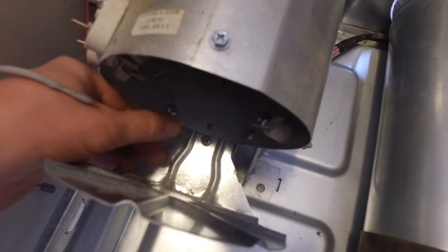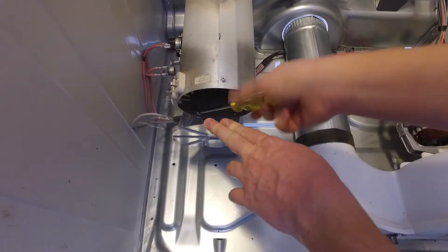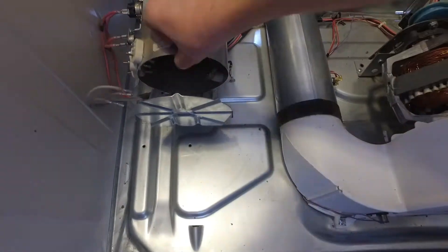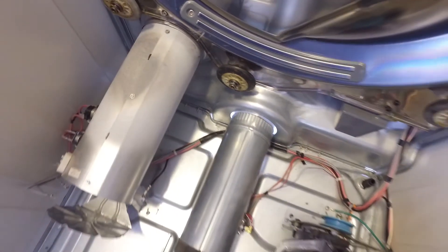We'll need to take a screwdriver — there are two screws on the inside there that we'll need to take out. This metal piece here, you can actually bend that back while you do this. But be careful when you take those out — do not cut yourself on that heating element because you could easily do that. On the back of the heating element, there's another screw. See the one I'm pointing to there? That's on the back — that will need to come out as well.